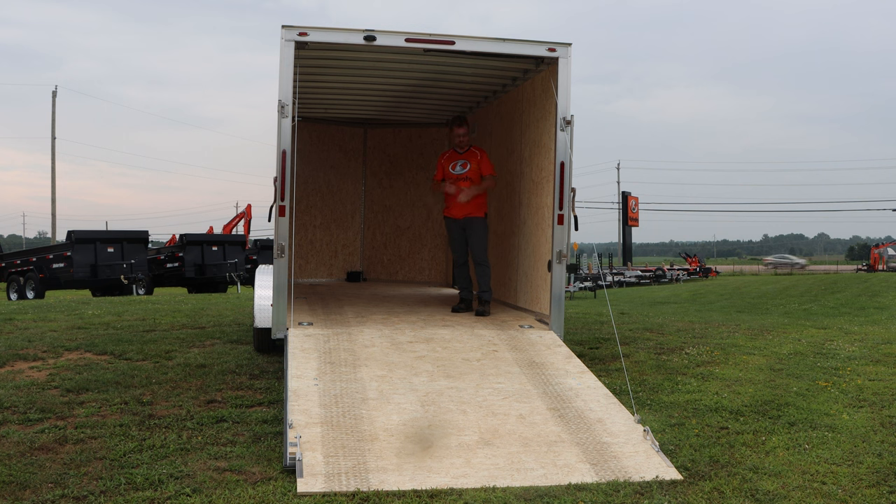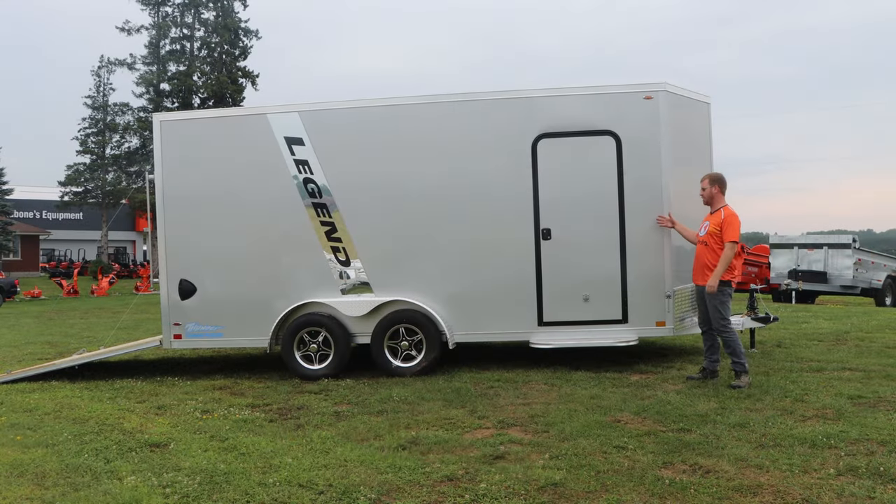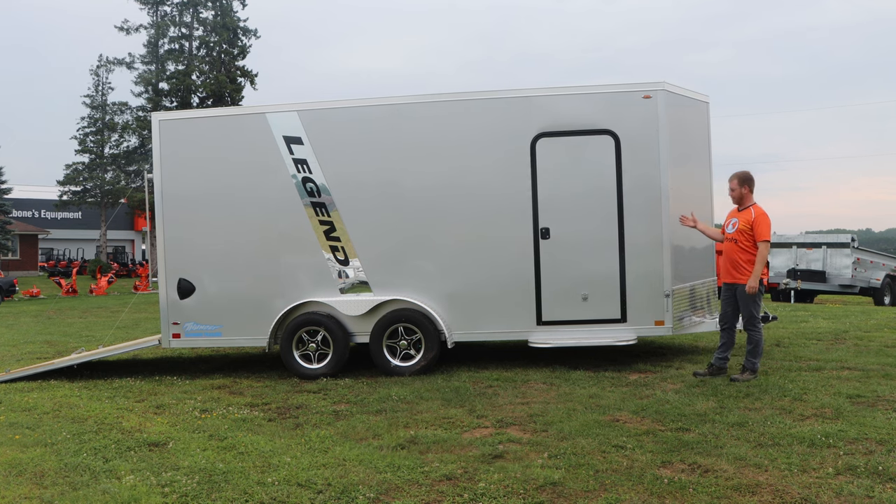When ordering a cargo trailer, your overall height is different at the back — there's a three or four inch header piece that constructs the trailer and joins the frame, so you lose inches on the door opening. What we've done is what they call a no-show beaver tail: a 24 inch slope on the inside that you don't see from the outside profile. That brings the peak point inside the trailer, gaining you two to three inches on the back opening. You actually have 84 inches of height both inside the trailer and at the opening.